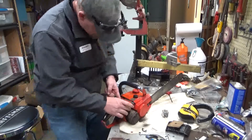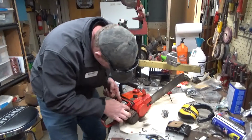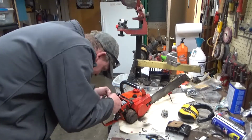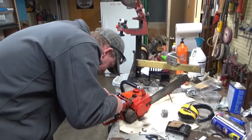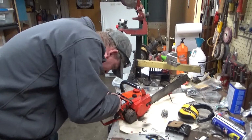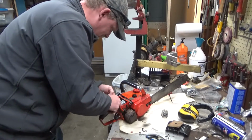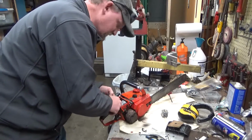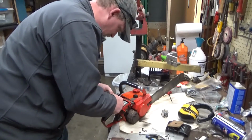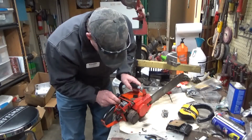The screws have got to go through both the idle screw grommet and then the high-low grommet down here, so you kind of got to mess with wiggling it around so that you get the screw heads to pop through without pushing the grommets completely out of the housing. That's what you don't want. I can assure you that trying to put them on after the carburetor is installed will result in nothing but cussing and broken grommets. So don't go that route. Just save yourself the hassle. It will not work.